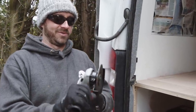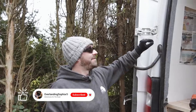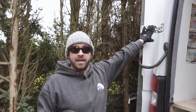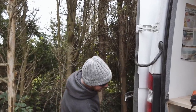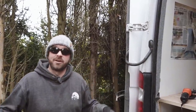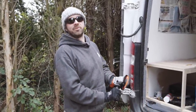This is the bit I'm not really looking forward to. I drew the holes - that's okay. Now I've got to take an angle grinder to this. First thing I've got to do is take out this hinge, because if I fit the wheel carrier whilst that's in, when I open it, it's just going to rip the sheet metal apparently. From the instructions, I need to cut it at a diagonal and then bring it out and chop the ends off and then hammerite it and let that dry. Gloves on, protective glasses on - nice hoodie.